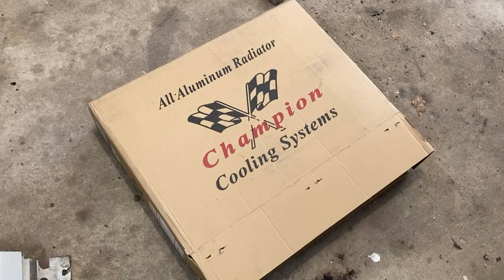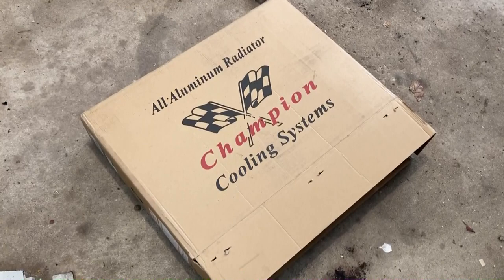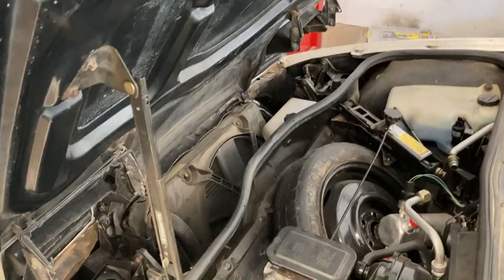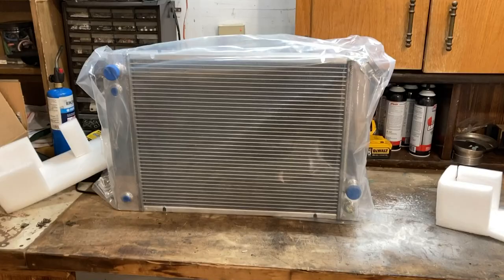Champion makes this radiator — I think it's originally designed for Chevy trucks but it has an extra core for a total of three real cores. I do have cooling issues on the highway with the 3800 supercharged engine. Running around 85 degrees outside for too long, the engine creeps up to around 220 to 230 degrees. I've got a 180-degree thermostat in there, so obviously the radiator is not rejecting enough heat — the answer is a bigger radiator.